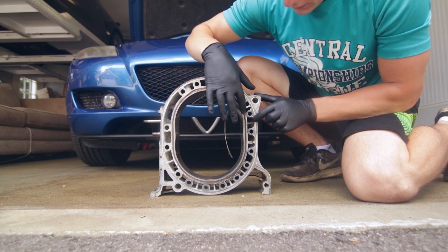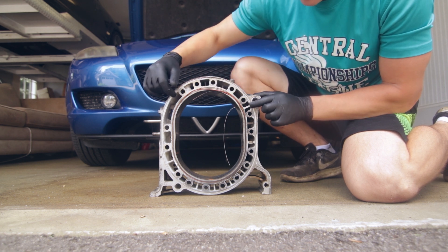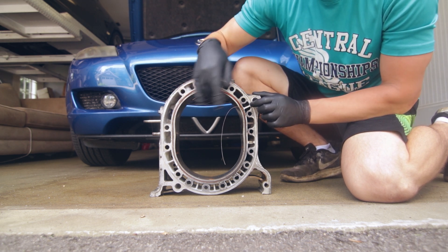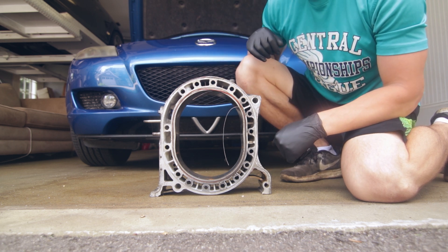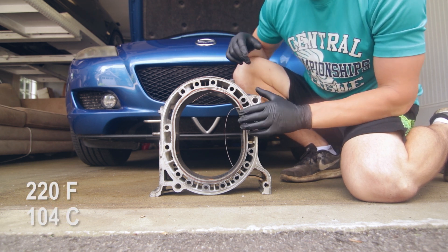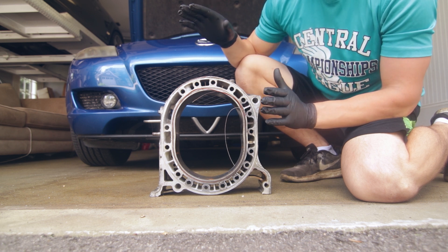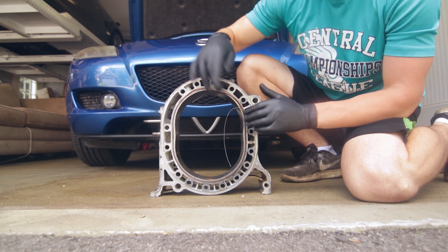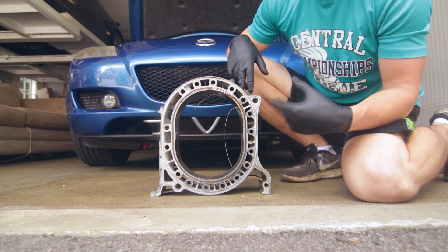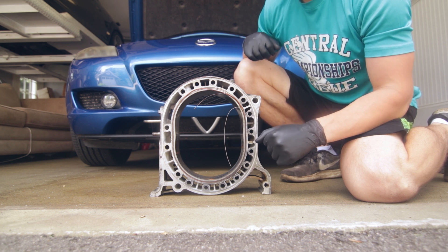In these two grooves there is a coolant seal jacket — one on the inside and one on the outside — and those keep the water sealed so it doesn't go into the engine or seep outside causing a coolant leak. These seals will start to fail at around 220 degrees Fahrenheit. If your water temperature gets up there, these things could blow and then your coolant could seep into your engine, seizing it up. Either way, if you blow one of these things you're going to need a complete rebuild, and that's very expensive.